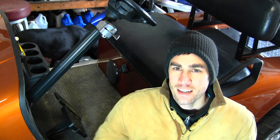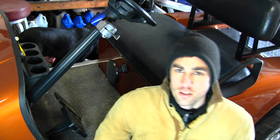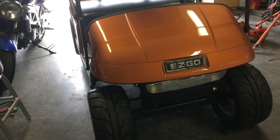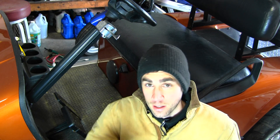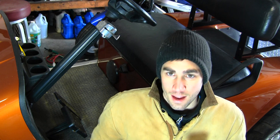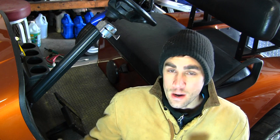Hey guys, Josh with Metal in Motion back at you with another video. Today I wanted to show you a very interesting thing that happened on this EZ-GO golf cart. A couple videos ago — I think it was my 'how to diagnose a small engine that's not running' video, I'll put a link in the description — I mentioned that I don't like resting the spark plug against the side of the engine and cranking it over to see if you have spark, because sometimes you can have spark outside the cylinder but not under 100 to 150 PSI of compression.